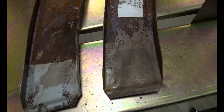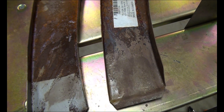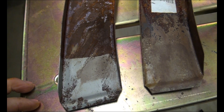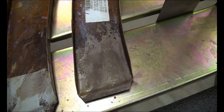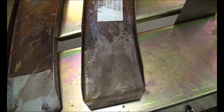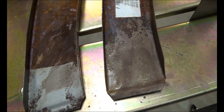Still a good product for what you need to use it for. But if I was doing something that I was going to be painting after, or I was concerned about other items on it — rubber, chrome, something like that — I would definitely use the rust release. If it was just a straight-up piece of metal that was heavily rusted and I just wanted to take the whole thing down, the Dr. X obviously did that. But if you're doing it, definitely make sure you do a good job washing and drying afterward or you're going to end up with something that looks like this rusted panel.